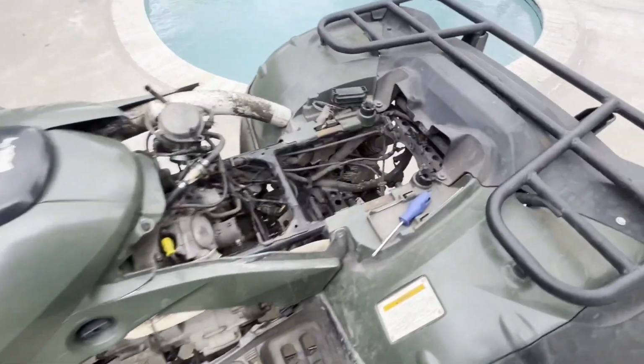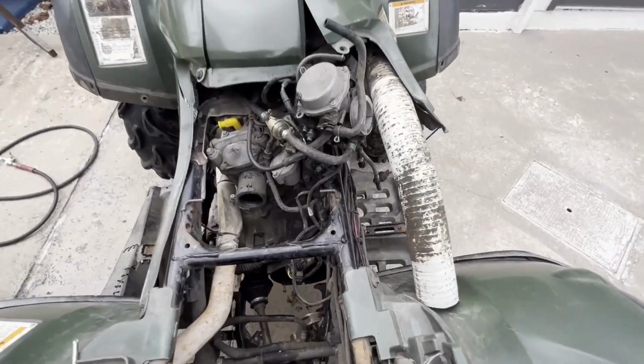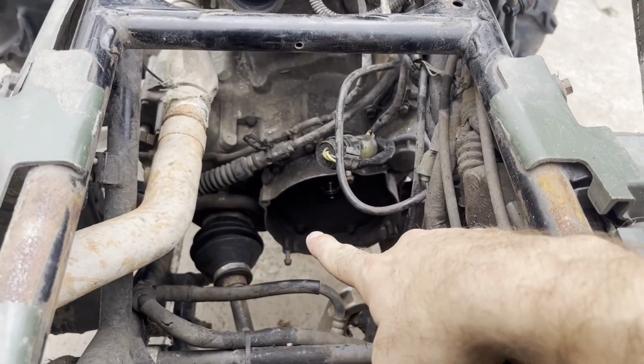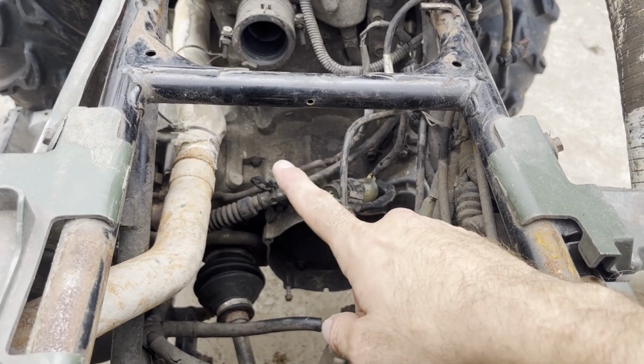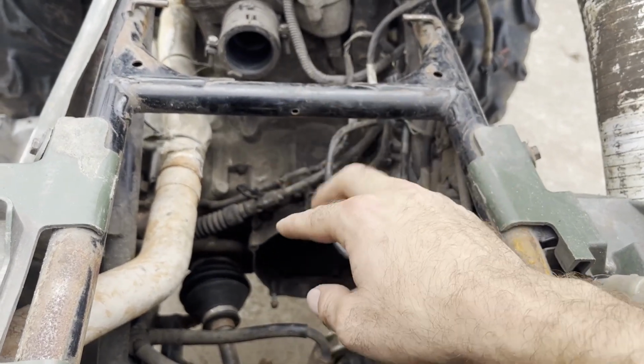All right, we got the air box seat off, carburetor and intake moved out of the way. So now I gotta go down in there, take these bolts out of here so that I get the stator out of there. Once that piece comes off, I can take all the bolts out of the case and start to inch that back. Cross my fingers I have enough room.